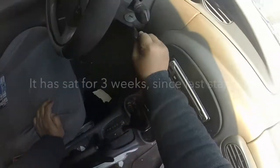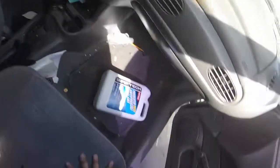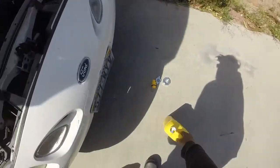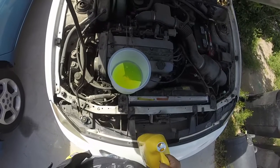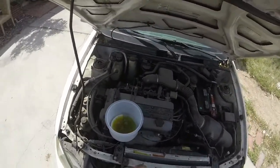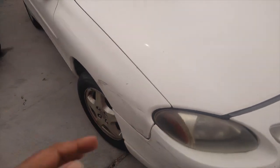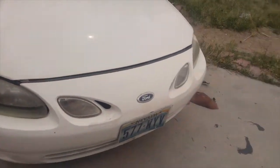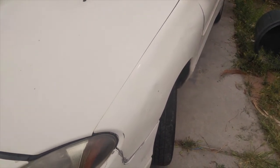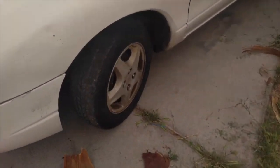So I'm going to start the car now. Coolant is bubbling — and look, the thermostat is opening up. It's got a new temperature sensor, new thermostat, cooling system is bled. It's basically ready to be on the road. We took it around the block — well, not a full test drive since it doesn't have registration — and temps were all good, nothing changed. The car seemed to be pretty stable even under hard acceleration or hard braking, and now it's ready to be sold to my friend.